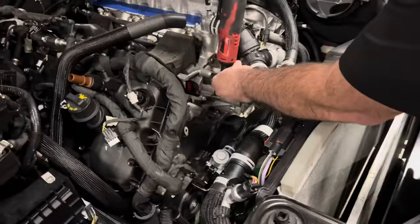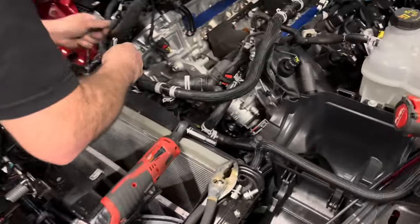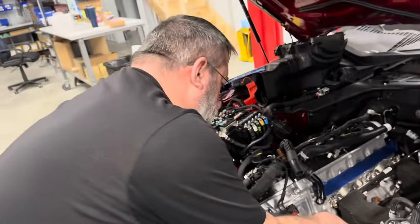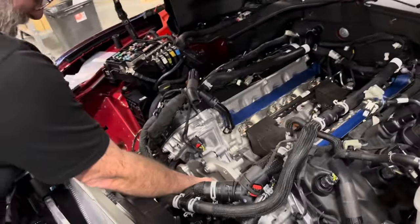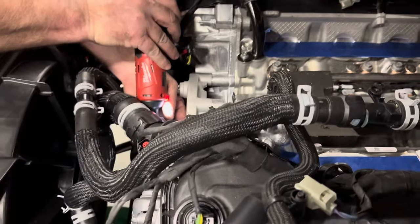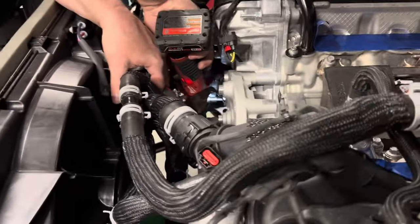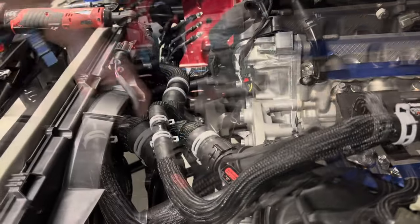Brian's going to take off a couple of bolts. They're going to give us some longer bolts to hook the bracket. When I start seeing brackets and pulleys going in, I start to get excited — thinking about some boost. Brian's pretty simple, takes it easy, keeps his nose clean — that's why we like Brian. A good practice is to get all the bolts in and kind of get them all working in first, not completely tightening them, get everything lined up, make sure everything's good, and then go around for a final round of tightening. These are all 22 foot-pounds on these bolts on this bracket.